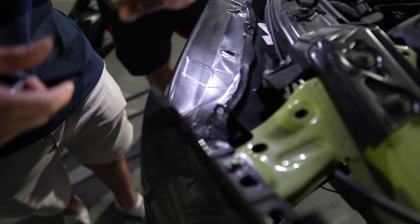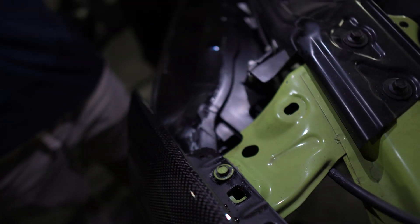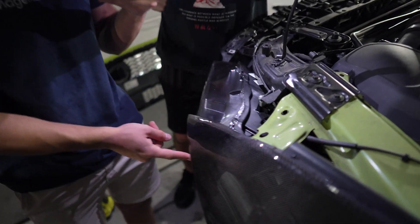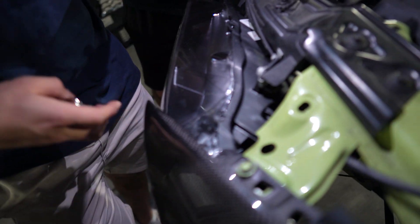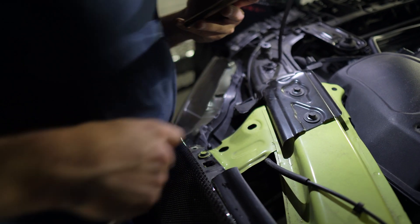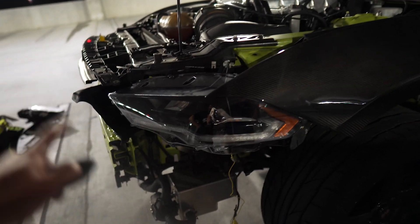It's the fender - I had some body work done and the guy pulled the bolt out right here. It wasn't really matching up with the hood when it came down and it was too far pulled out. So the headlight fitment wasn't good. We're just going to fix that by loosening it up, then I'll lean on it and tighten the bolt.